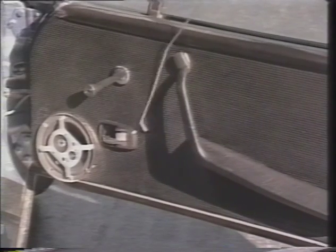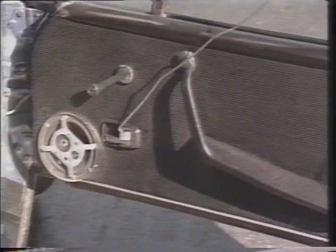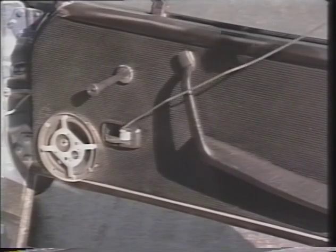The tool is designed to be bent so it can creep around anti-theft devices in most cars. You simply unbend it afterwards. The small end of the Z-Tool consists of a double-bited sawtooth edge. It's quite sharp, can reach inside windows and grab rubber, metal, and plastic buttons and releases and pull them loose.